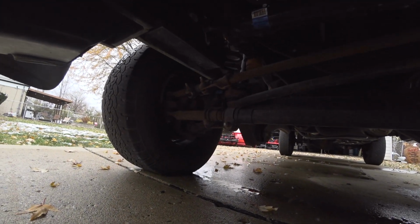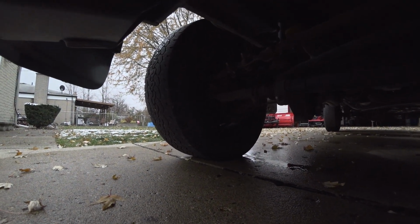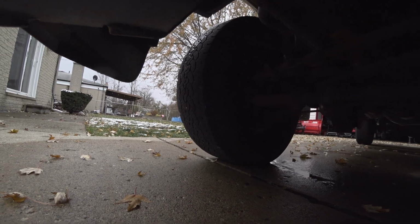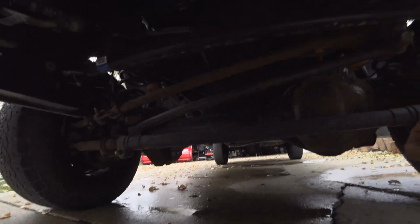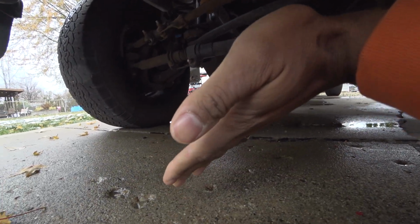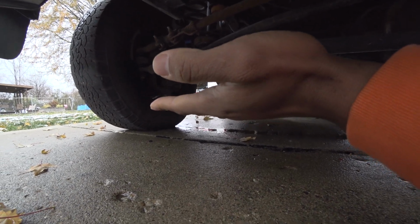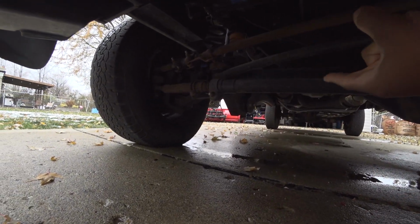So say if you hang 1,000 pounds off the front, you're going to effectively bring the front end down, but it's not going to throw off the geometry, it's not going to cause scrubbing with the tires, and it won't change the alignment. With the independent front suspension that you find on the GMC Chevy product, the front end geometry is effectively changed because you have control arms, and you have either rack and pinion, or even if you have a gear, and even if the linkages are connected across from each other and not on the frame of the truck, because the control arm straightens out more when it gets loaded, the geometry changes and causes a need for a change in the length of this linkage in order to maintain the same alignment.